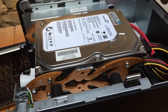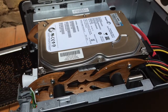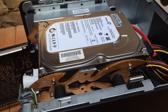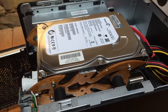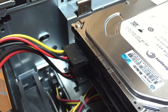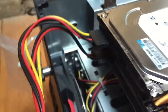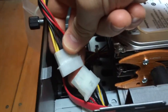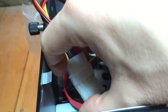As you can see, I've got my two drives mounted to a bracket here — I'll put a link again in the description below. Unfortunately, this bracket did require some modification in order to fit into the microserver case, but it works quite well once it's in. I've attached the twin SATA to Molex power adapter to my two drives, and the other end of the Molex adapter here just connects into the spare slot in the top of the server.